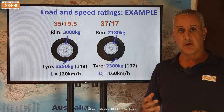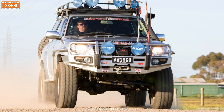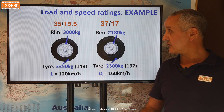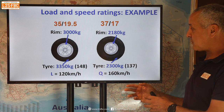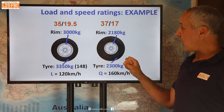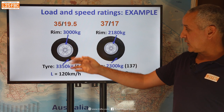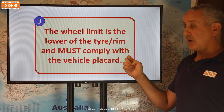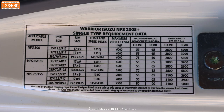The 37-inch tyres on 17-inch rims really came out of the modified four-wheel-drive world — highly modified Jeeps, GQ Patrols and similar — vehicles weighing towards three tons maximum. They weren't designed for vehicles weighing six to seven tons which then tow another three or four tons. The 19.5-inch rims with smaller diameter tyres are what's designed for that. The 37/17 is an off-road flotation tyre but doesn't have the load-carrying ability that a smaller tyre on a larger rim has. The wheel limit is the lower of the tyre and rim combination, and it must comply with — i.e. be equal to or greater than — whatever is stated on the vehicle placard, for safety and legality.